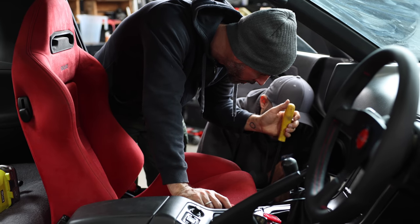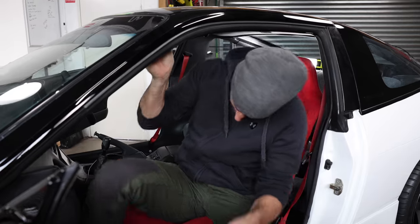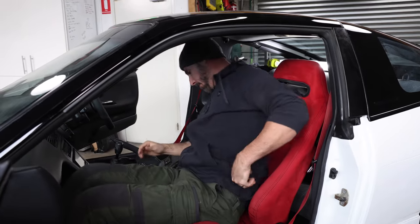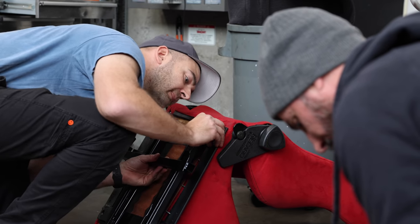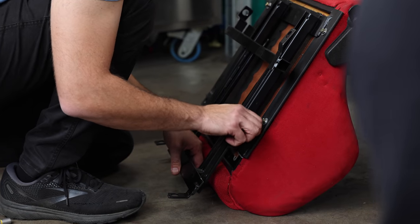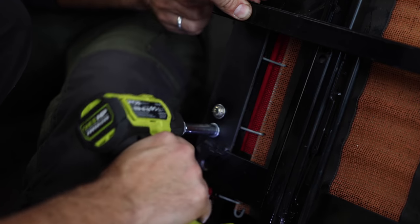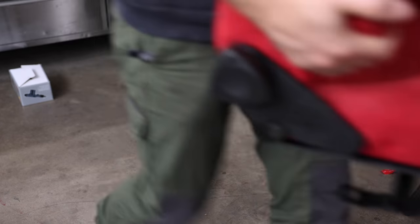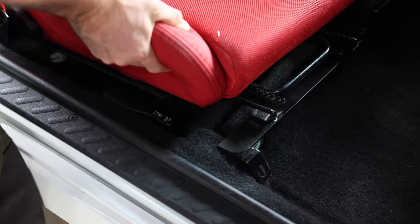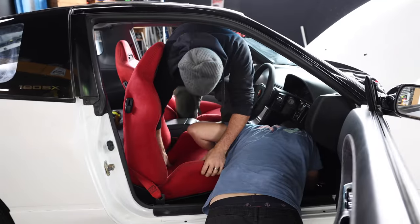With the new steering wheel installed, now I can move on to the seats. Using seats in a car that were not designed for it usually requires the use of adapter rails. These convert the factory seat mounting positions on the car to the mounts on the seats—well, they're meant to, but they don't always fit. You may need a pry bar, hammer, drill, or even a welder depending on what your setup requires. Bolt-on doesn't always mean bolt-on. There are loads of cheap and fake seats available, but for a build like this it was really important to have genuine seats that are quality. Recaros like this are expensive, even second hand, but they are totally worth it because they're some of the best seats available. I'm stoked to have such awesome quality in my 180.